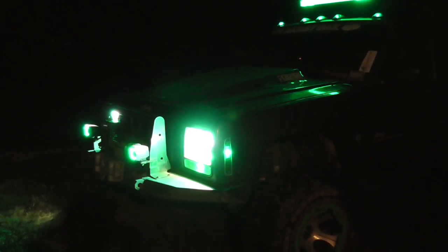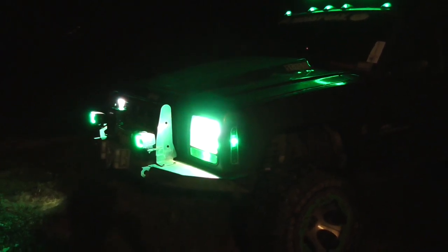I might be getting the upper control arms tomorrow. If I do, I'll be working on the front axle, doing the lower control arm bushings, upper control arm bushings, and upper control arms. And then to the alignment shop, because I think a lot of the reason might be alignment. I don't think that's the whole thing, but I think a lot of it might be. And I need to double check my track bar, make sure my axle is even. It might not be.